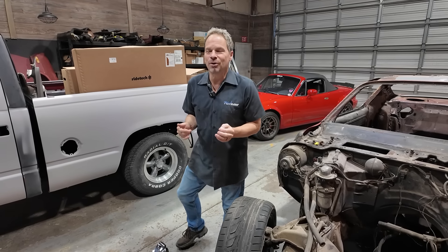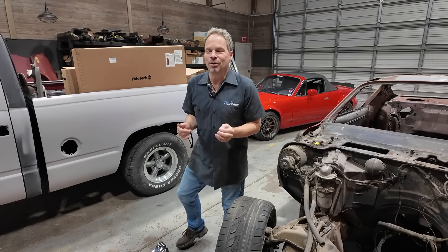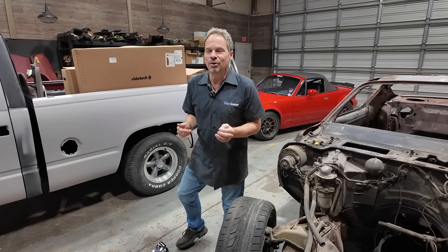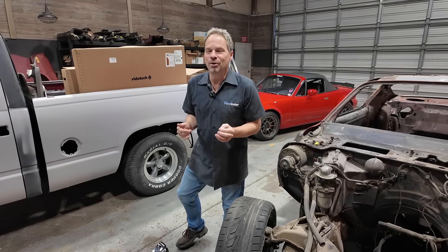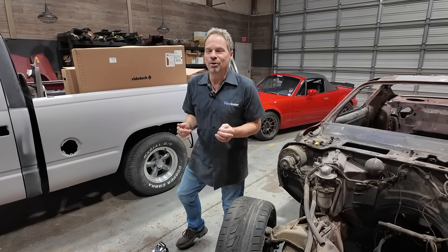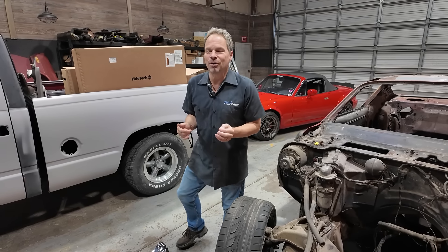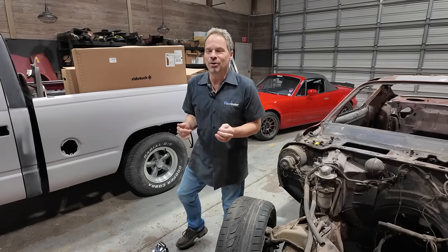I did one more thing — I had a suspicion and we chipped off enough filler to confirm it. There was a layer of mud here that was interfering with this style line, so I ground this flat and look at this — this is the peak of the metal that runs right into this style line here. This absolutely confirms that this door is in the right place. Now we are ready to basically back-half this car: skin the quarter panels, replace the trunk floor, rear body panel, make it into the round tail-light 1970 model, and of course a roof skin.